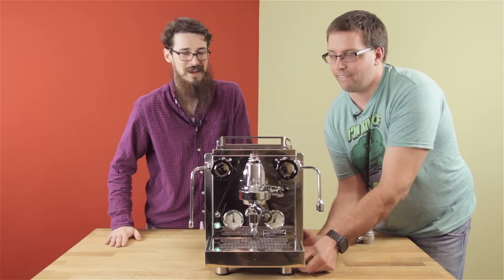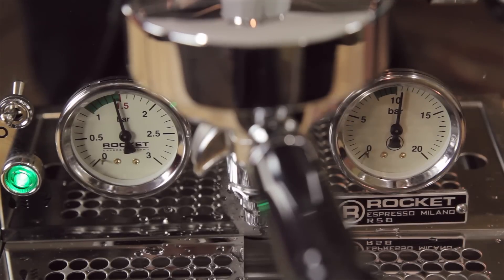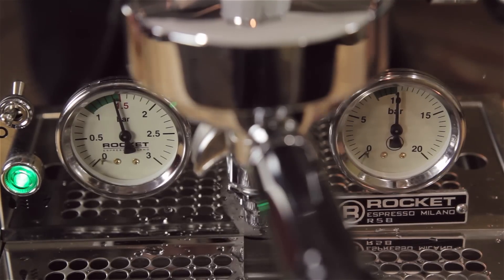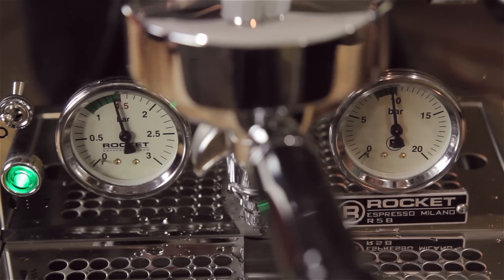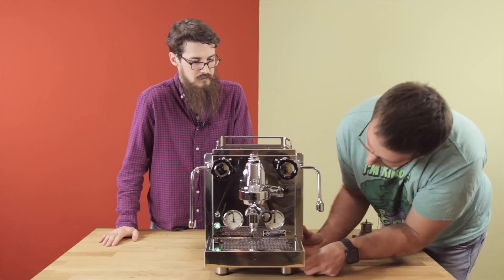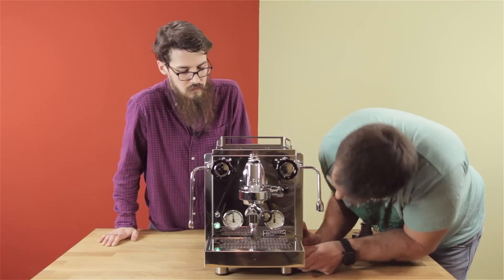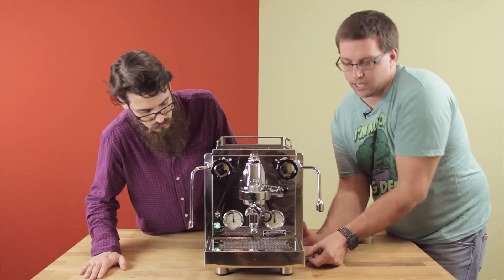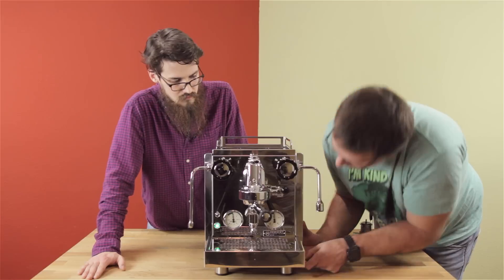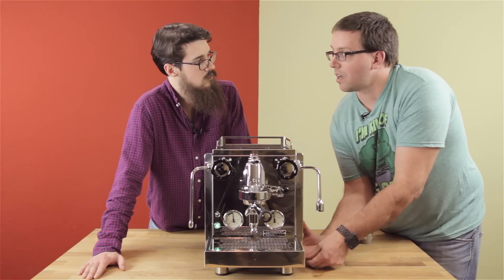As you keep going — the squeal is gone — we're almost to 10. All the water has stopped coming out of the pin now because the expansion valve's holding and not allowing it to go, because that's set to go off at 12. What I like to do with the blank portafilter in there is get it to about nine and a half, because then with your coffee it should come out around nine.